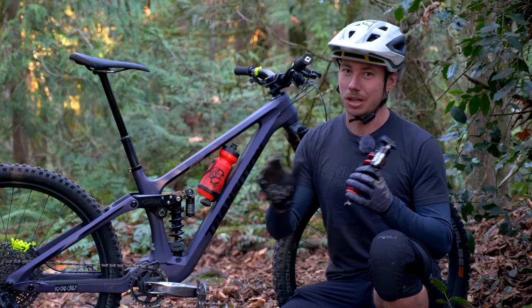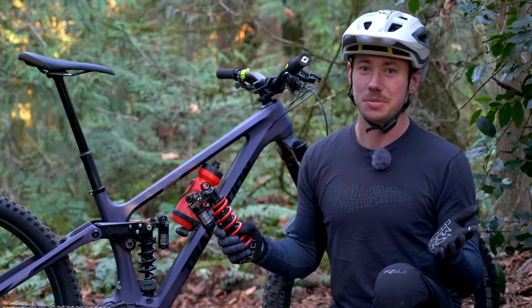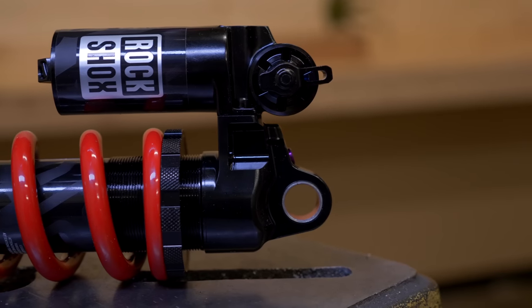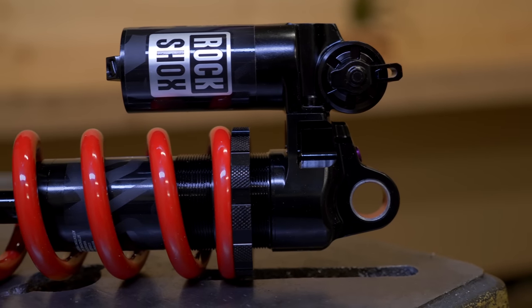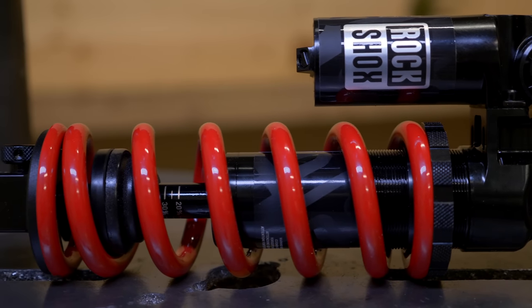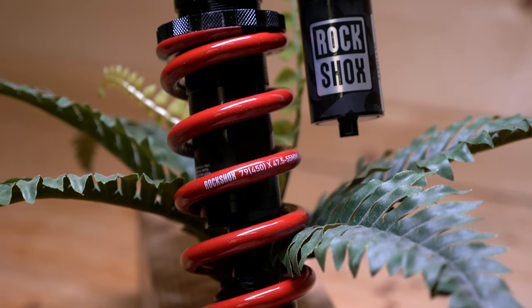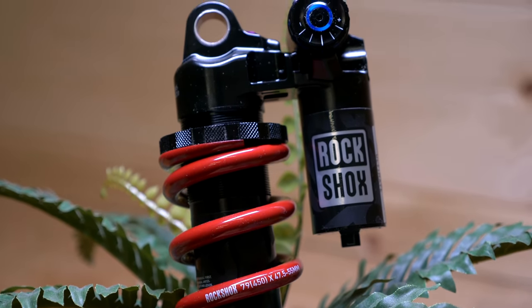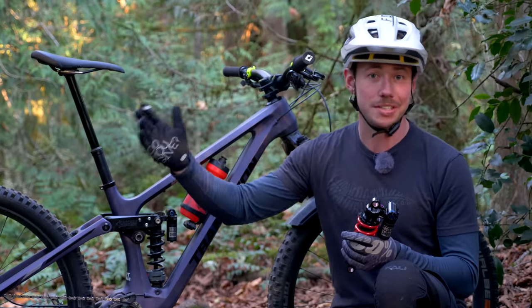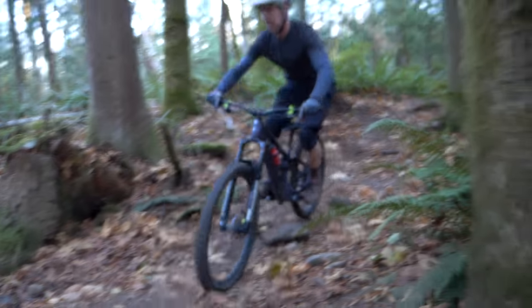Another little feature that makes so much sense on the RC2T damper is the little tick marks on the outside of the adjusters that tell you exactly where you are in your compression or HBO circuits. You can just look down and see exactly how many clicks you're running without having to get out the multi-tool and count. RockShox also offers bike-specific tunes for their new shocks, meaning your Super Deluxe Coil can be tuned specifically for the bike you install it on to get the absolute most performance out of your shock. Custom tuning is most important for riders whose weight is farther out on either side of the spectrum, either under 140 pounds or over about 210 pounds.